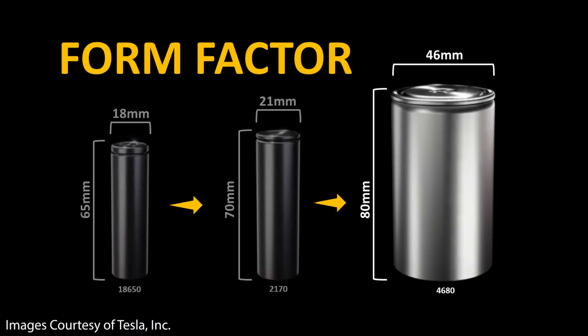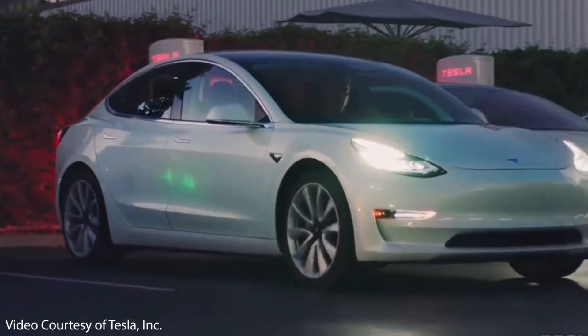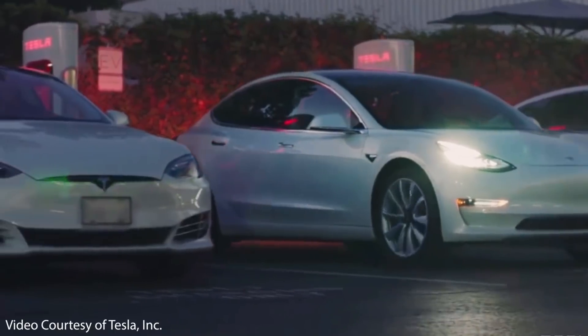In summary, the tabless battery design from Tesla not only generates less heat and greatly reduces electrical current and temperature variations within the cell, but the design also allows for more effective heat dissipation to the ends of the battery cells, eliminating the thermal issues that would normally be associated with such a large battery. Ultimately, the tabless design combined with other aspects of the battery technology should allow these batteries to charge and discharge at very high rates without damaging them — making them very practical and impressive, while also reducing production costs.